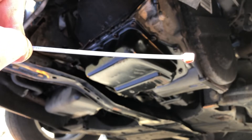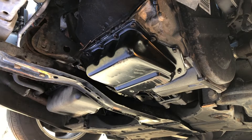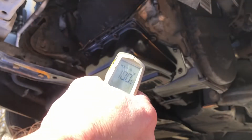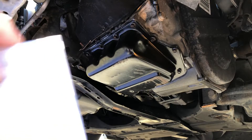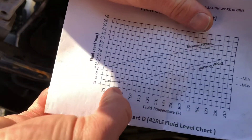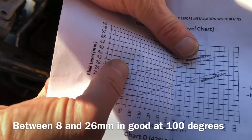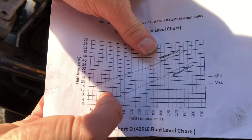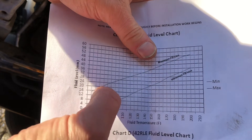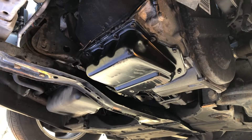I'm not quite to 20mm — I'm right about at 18, and I'm at about 100 degrees. At 100 degrees and 18mm, I'm still good — even if that was 20mm I'd just be a little bit on the high side. At 100 degrees and even at 20mm, I'm probably about perfect. So let me take this out for a ride, get it into all the different gears, and then I'll come back and we'll try this again.